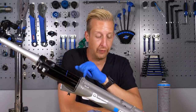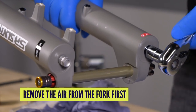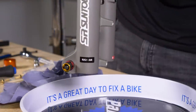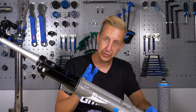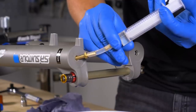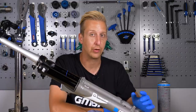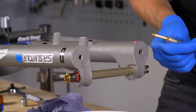There's one other method to get lube into the lower legs of your fork. When you undo the foot bolts on a fork, you'll find there will be some excess — probably quite grimy — lube in there. Make sure you have an oil pan or old container to catch that oil for recycling. You don't need to do a full lower leg service at this point — just pull the lower legs slightly away from the foot bolts to gain access and put some fresh lube back in. Make sure you use the correct volume and type of oil for your specific fork model. It doesn't take much time and it will make your fork feel noticeably slicker.